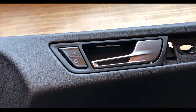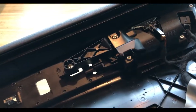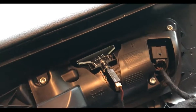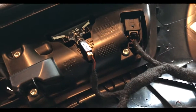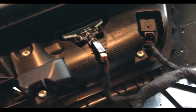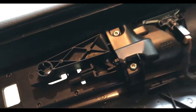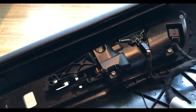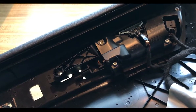The most annoying part is getting the spring in the right place. You have to insert the spring first and then push a pin through to hold it in place. On the back side of the door, you can see there's a series of torx screws that have to be taken out, as well as two connectors — one for the illumination, the other for the door lock. Once you get that out, you can pop out the pin that holds in your stock handle, then wrestle in the new one and you're pretty much all set.